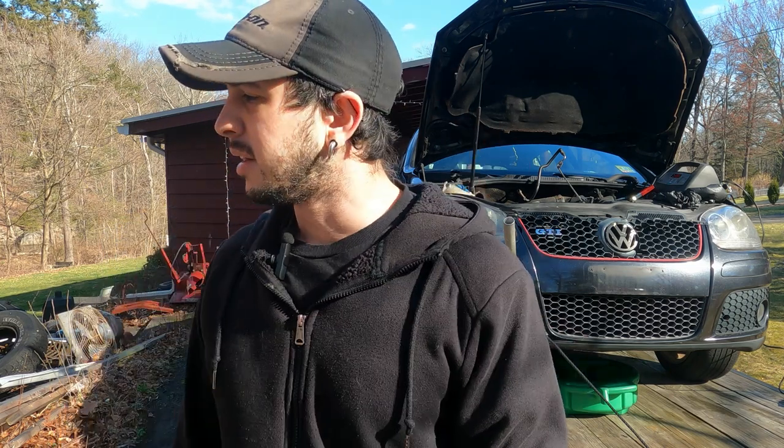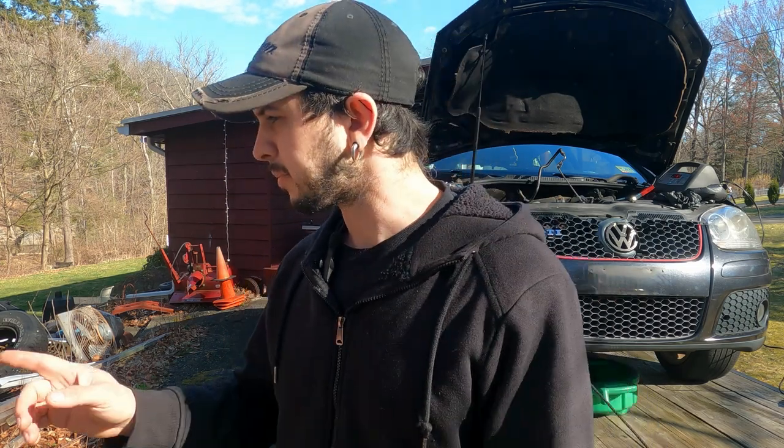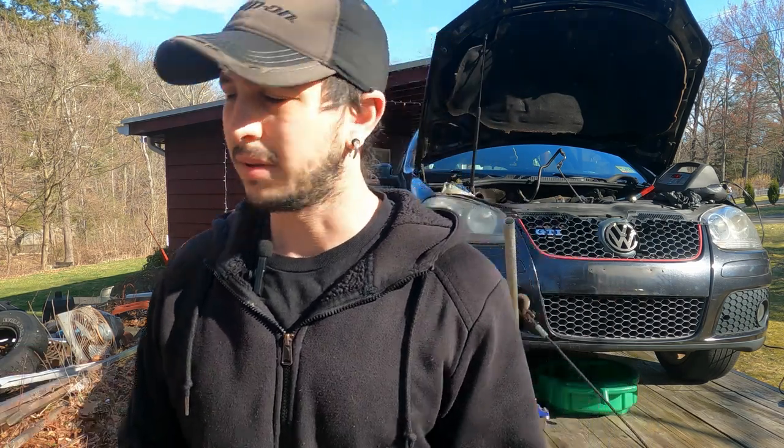Welcome back to, I don't know, day 3, 4, whatever. It's Sunday. I got all my parts finally. Don't think I'm gonna run into any more issues. So let's get this thing put back together and see if we can hear this run this morning. I'm gonna start with the oil pump. So I'll pull the pan, put the new oil pump on, put the new pan on. Then we got the new oil cooler. I'll show you that.